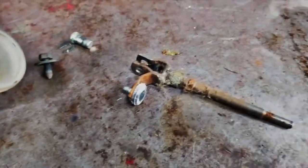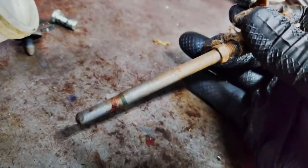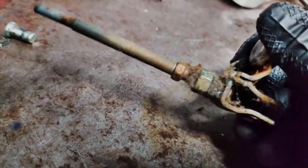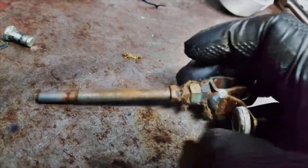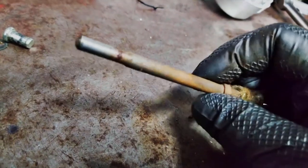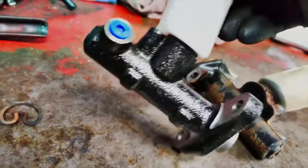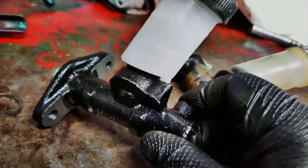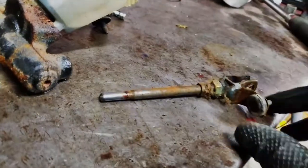This is everything else. This rod actually just sticks into the back of this. If you want to line all that up in-car, you can leave this in place and just pull the cylinder. I pulled this out anyway because I want to be able to clean it all up and to me it makes it easier to get it in and make sure it's lined up correctly. So here is the new one — I'm just going to get this back in and then put the rod back in.